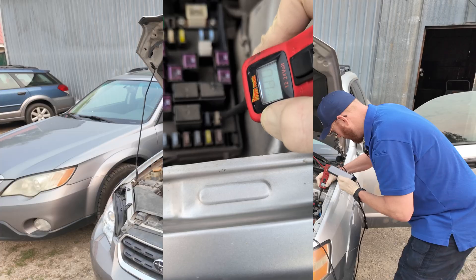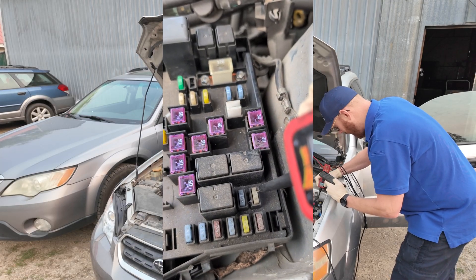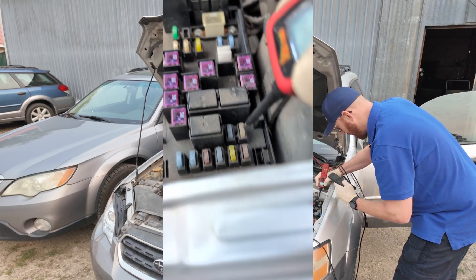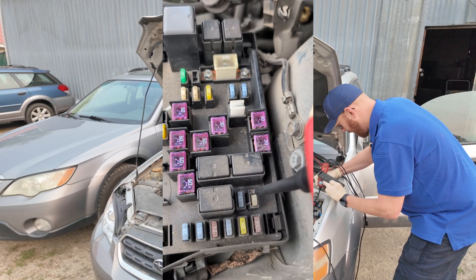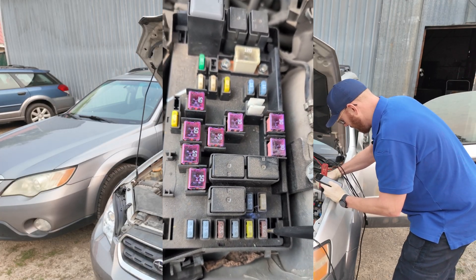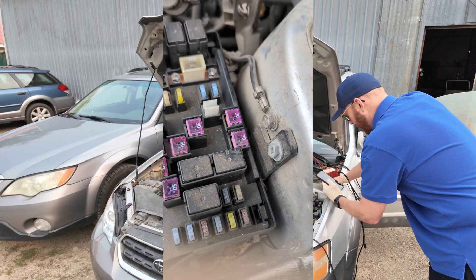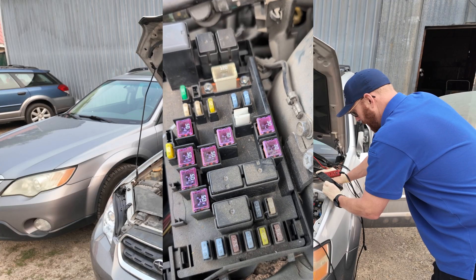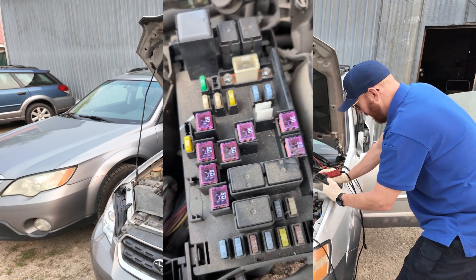Here's a good example — sometimes a fuse is not actually being energized right now, so it has ground and ground. If the fuse has ground on both sides and you know the circuit you're trying to test should be active, this fuse is irrelevant. What I'm looking for is a beep on one side and a boop on the other side — then I know I have a blown fuse. Then you can hook up a fuse buddy, because you don't want to just chuck a fuse into a blown circuit. Use a light or a fuse buddy to get an idea of what's actually going through that circuit.